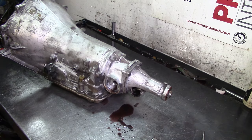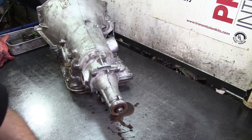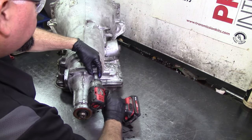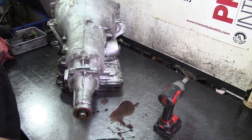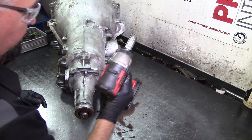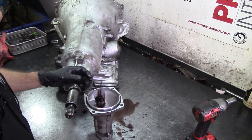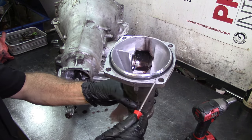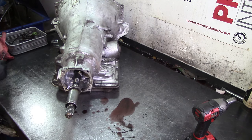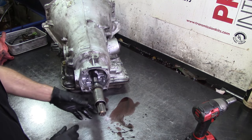I've got black gloves — with the pandemic, gloves are hard to find, but whenever I find them I buy a case. 15mm socket to remove the extension housing. When you're doing a full rebuild it's easier to take the seals off before you disassemble while everything is supported. Extension housing seal — it's a square or lathe-cut seal. Put this to the side.